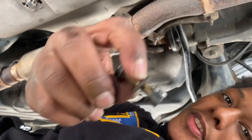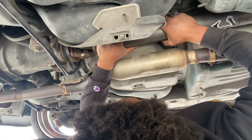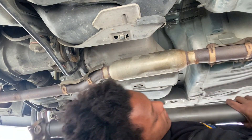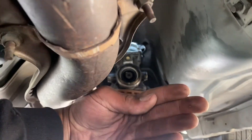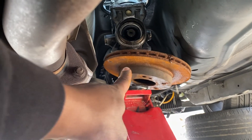I almost stripped a bolt. I have to elevate the transmission slightly so the back of the driveshaft can tilt down. I had a rotor sitting on that.